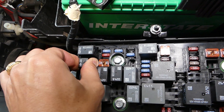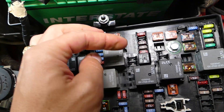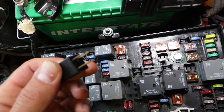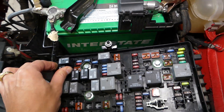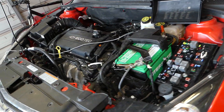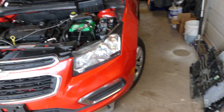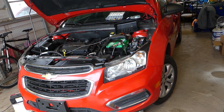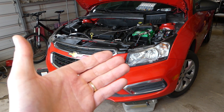If you have it, you will be able to push it in like that. But ours doesn't have even connectors on the inside. Because the 2012 and up — most of the Cruze vehicles in the US — will not have a fuel pump relay. They have a fuel pump module instead. The module controls the pump and everything else.